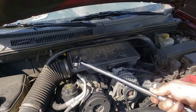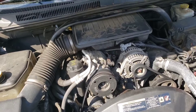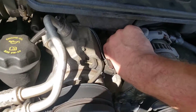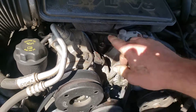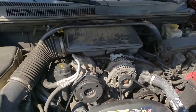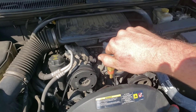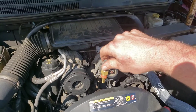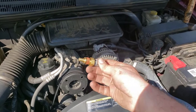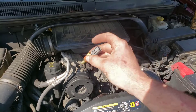You could just use a regular half-inch ratchet. I've already broken mine loose, so I think it'll just spin with my fingers. You might have to take a ratchet and just ratchet it loose a little bit, but eventually just take it off with your fingers. Then of course put the new one in, twist it, just snug it — you do not want to break this off in there. So again, just those German torque specs, 'guten tight,' just snug them in there. Then click the connector piece back on.